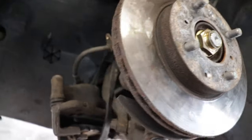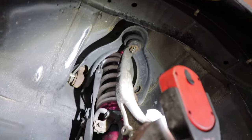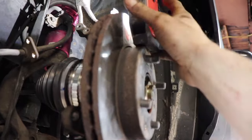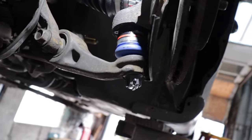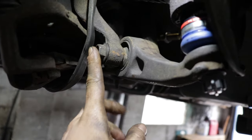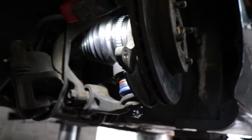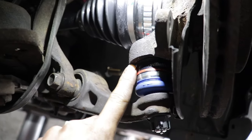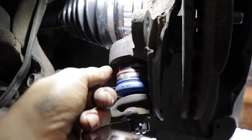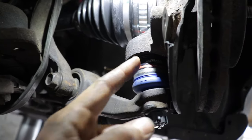As far as putting everything back together, it's pretty simple. I put the upper ball joint in first, then slide the axle in, and then you get the lower ball joint on. Best way is to jack it up so you can straighten everything out and get it right. You just have to have a snap ring plier — otherwise you're not going to get what you need.